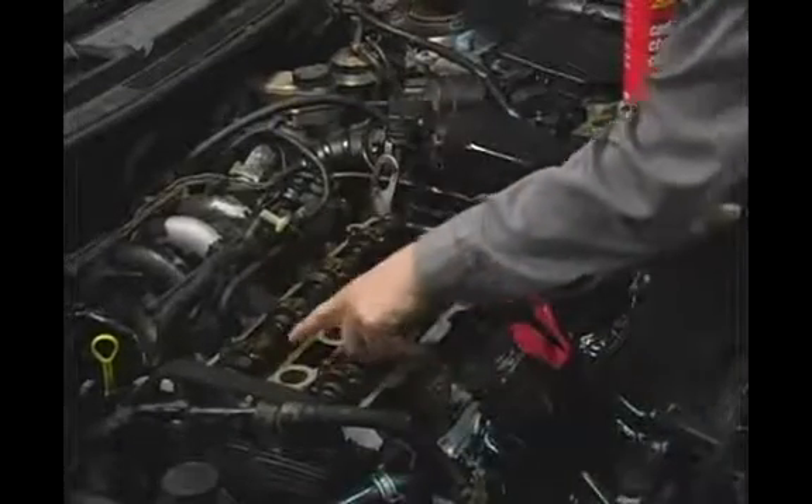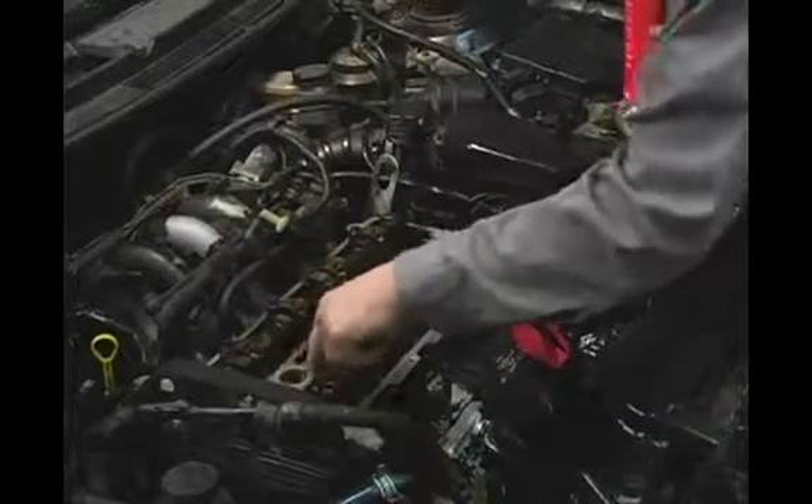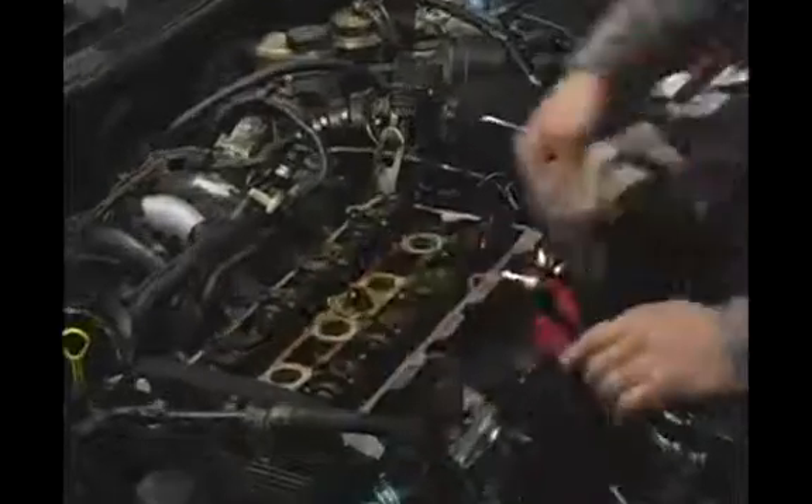All of this here does not get gasket on it — only right around there. You can actually see the ring from where the gasket seats. It's not necessary to clean up any of the other stuff. There will be one plug galley for every cylinder your engine has. This is a four-cylinder so we've got four — make sure to get them all. If you are not sure what size or how many cylinders your engine has, refer to the owner's manual; it will let you know.